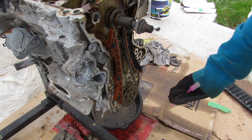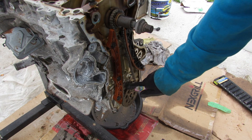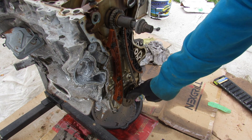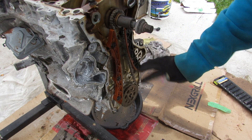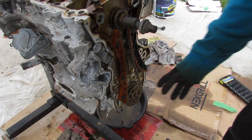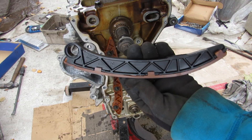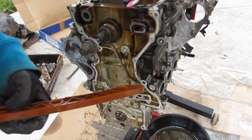Taking a look at the timing chain setup on this engine — it is so simple, especially compared to that Audi I took apart last time. There is a single overhead camshaft driven off of a crankshaft, and the timing chain tensioner plugs in here. That's pretty much it — there's no variable valve timing, no extra pulleys for the water pump, not even a chain tensioner idler. It's just a crank driving a camshaft, and that's what makes these engines so simple. The cam is very disconnected from the head — I can just peel off that chain. There's a hex over here that needs removal, and these are made of plastic. I can take off the 10mm bolts for the other slide and remove the plastic slide.